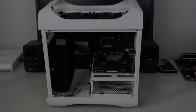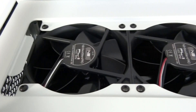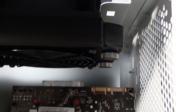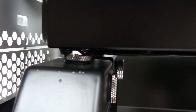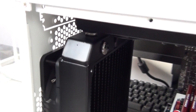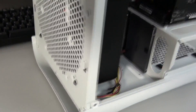I've now installed the graphics card and also the fans and radiators, but I may not stick with this particular configuration — I'm not happy with the way it looks. The radiators get too close where they meet and it makes the build look cramped, so I'll probably end up installing the fans on the other side of the radiators and turning one of the radiators around. I've also installed grills on the top radiator that I'm going to remove. As for why I haven't used a 200mm on the front panel — I like to match up my radiator brands, and I wanted Alphacool Nexus radiators with the specifications I was after. I also prefer the available 180mm fans over the 200mm options.